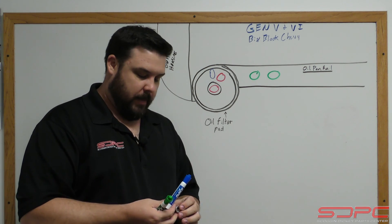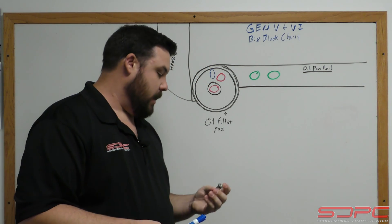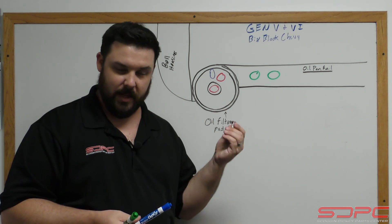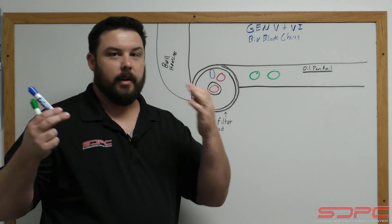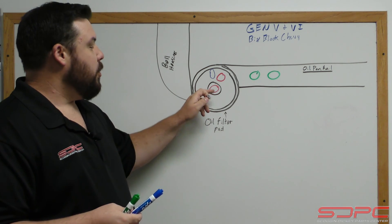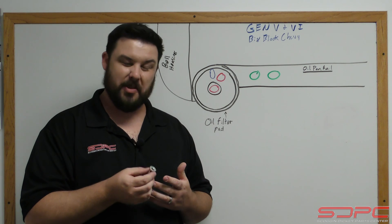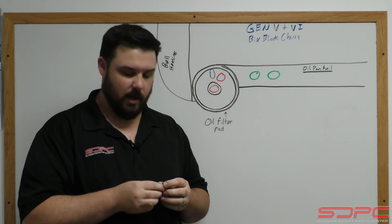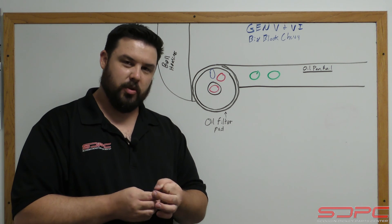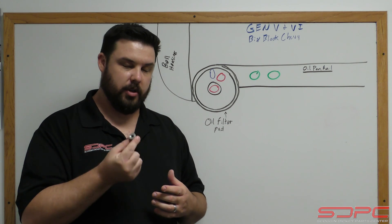These engines came from the factory with these little valves installed dead center here where the oil filter screws on, and also installed right next to where the oil inlet is. If you want to run one of these engines without an oil cooler — because that's what these two 3/8 NPT ports are for — you plug those off. You can get an allen head plug or hex head; it doesn't matter, just make sure it's 3/8 NPT. Put some thread sealant on it, clean it up, install those in, hand torque them and you'll be fine. Then you'll remove the valve from the center of the oil filter. Most people remove these little valves with a screwdriver or a pair of pliers. We've actually noticed the easiest way is to find the right size drill bit to bite on the inside of this hole — if I remember correctly I want to say it's a 3/8 drill bit, but you'll have to test and find out. Use the drill bit to bite into the metal, grab a pair of pliers, and pull them out. They're pressed in but they aren't pressed in that hard, so don't do any damage but you should be able to get one out.